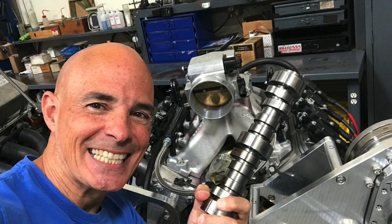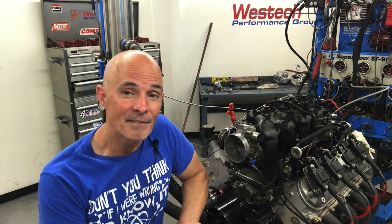In this case on our little 4.8 liter it's the factory LS9 cam. The LS9 cam is the most powerful factory cam GM ever offered — something it shares with the LS7 cam. When I tested both of those they basically make the same power, but I like the LS9 version even better because it's cheap. Guys sell them for $160 brand new and even cheaper used. That factory cam offers a lot of power, it's accessible, and it's inexpensive.